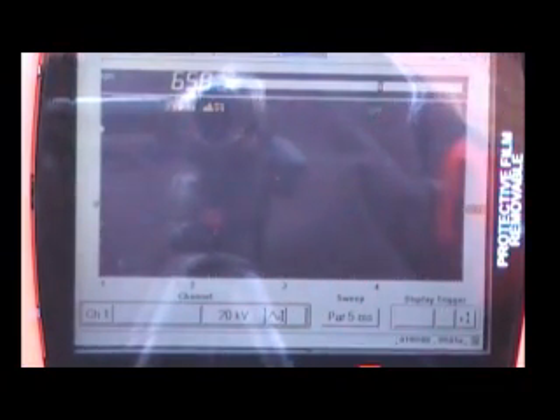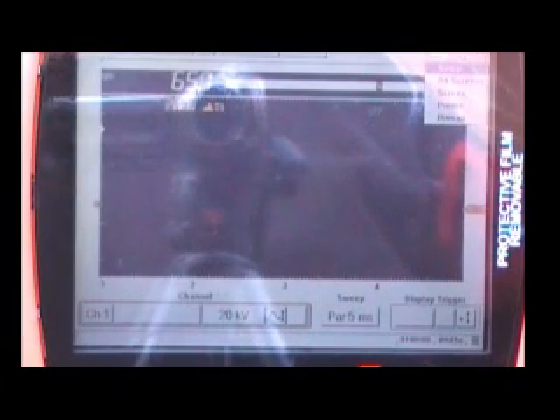That's your cursor you can use to measure with. That's your snapshot button there to allow you to take a snapshot. And that's your reset — resets your min/max values and things like that. Your file icon actually allows you to save different screens. Press No. Go back over to print if you need to print. And then here's your toolbox option — this is where we need to stop and take a moment to go over the setup on your ignition scope.